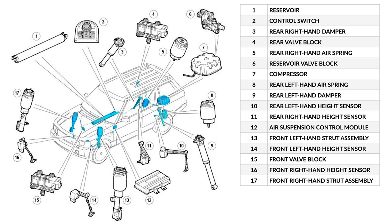So if we look at 13 and 17 on this diagram, which are the front left and right hand strut assemblies which have got the airbag on the top, and numbers 5 and 8, which are the rear right and left hand air springs. If we leave the car in raised mode overnight and come back tomorrow and have a look, if there's any significant splits in those bags, the car will have deflated beyond its backside on the bump stops,